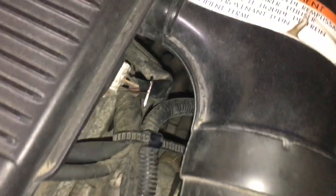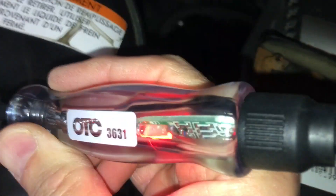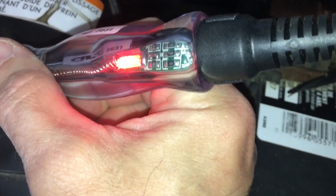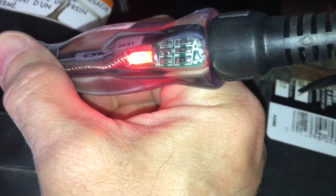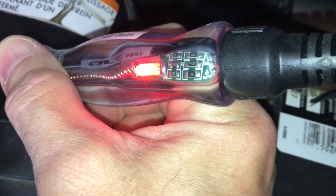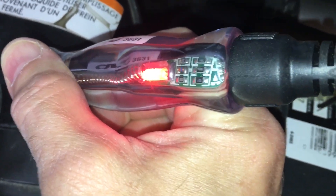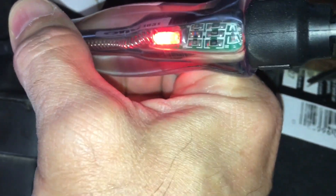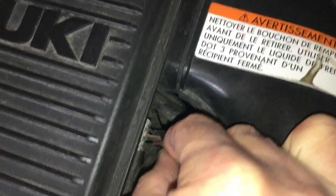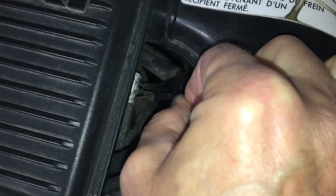Now I'm on the black and red wire - let's see what we have here. We have power. This could be the signal line, but it's definitely not the ground - because otherwise why would there be power on it? So we know that's either the signal or the power, and the other line we looked at is either the signal or possibly the ground.